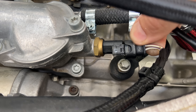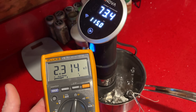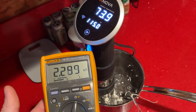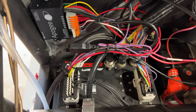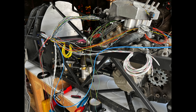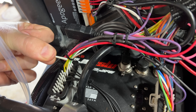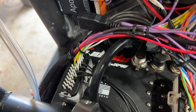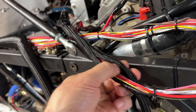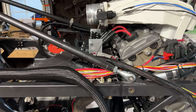I reused the existing temperature sensor. You can heat up water with the sensor in the water, get three different temperatures and resistances, and then program that into the ECU. The rest of the harness came with the MS3 Pro — two waterproof connectors with several wires coming out of each. I used about half the wires; there are a lot of extra wires for inputs and outputs. When you're done, you can remove the unused wires with a special tool, but you'll need to plug the hole with a seal. You can also just cut the wires short and shove them out of the way, but using the tool is way cleaner. I used split looms to protect the wires — not the most robust, but there's a high likelihood I'll be modifying this harness in the future, and they make that way easier.